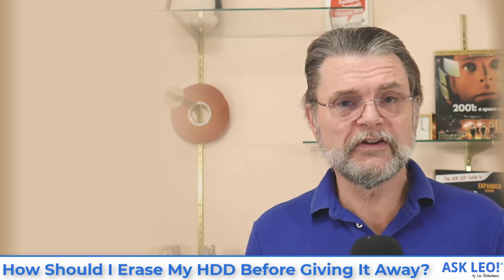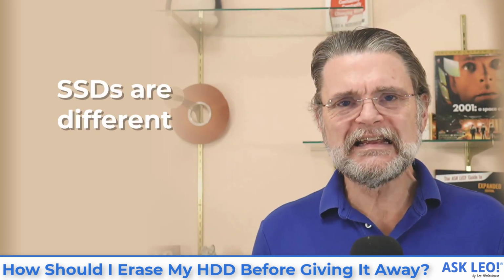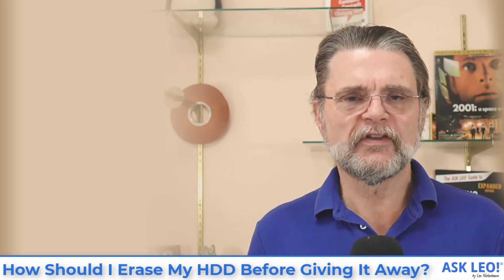Now, one thing I do need to caution you about, and this is something that's changed in recent years: SSDs are different. You do not want to run a tool like DBAN on an SSD.